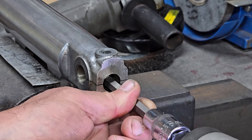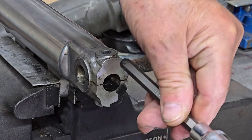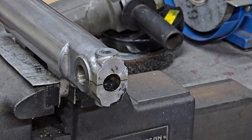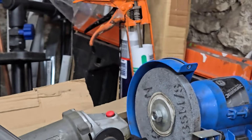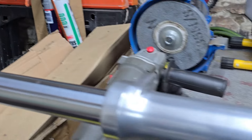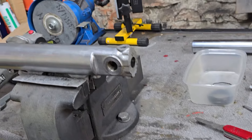Even though I loosened it, it's spinning - the rod in there is just spinning as well. So obviously Yamaha expected you to go and buy an extremely expensive special tool. Usually what I do is get the end of a broom handle and put it down here, which holds the damper rod in place because the wood bites into it, and then have another go at the bolt.